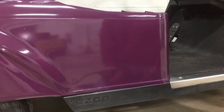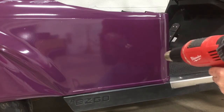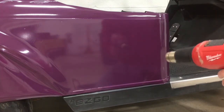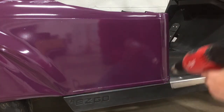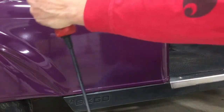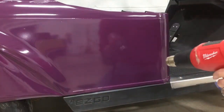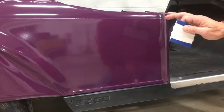If you have a heat gun, it's always recommended you use one. When warming the surface, you want to get it up to between 185 and 225 degrees, just for a second. You wouldn't hold the heat gun still — you're constantly waving over the surface. By doing that warming, you're activating that adhesive to take its permanent bond and stay in position. That's a very important part of your install, and this is done once it's all complete.